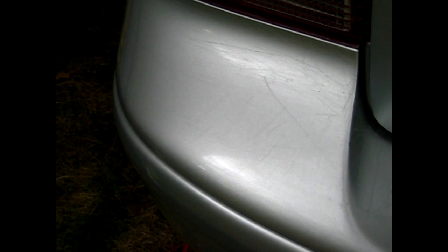Now what I'm going to need for this is some rubbing compound. You can compound the scratched area by hand or with a buffer, which I'll be using. Then after that you'll want some scratch remover. The polishing compound is a little more coarse, and the scratch remover is finer — just to finish up the fine scratches that the polishing compound leaves in your paint.